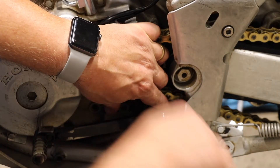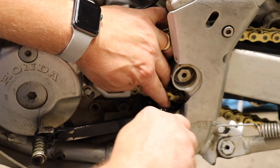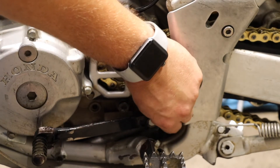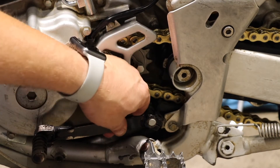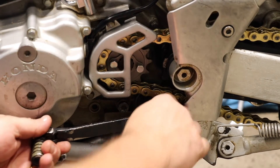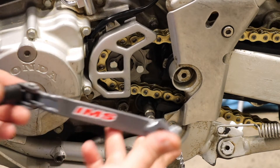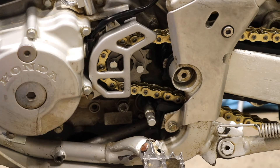We'll keep this as a spare, and most of the parts we are replacing on this we are keeping, except for maybe the headlights and whatnot — we'll put those on eBay. Go ahead and take the screw all the way out and you can just slide the old shifter off. Sometimes easier said than done. We're going to replace it with this IMS unit here. This is the only thing I could find that was made to fit this particular XR250R, or any of them.